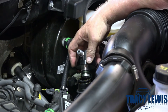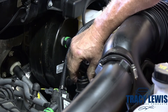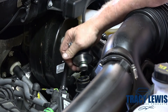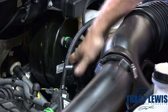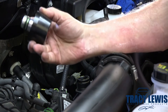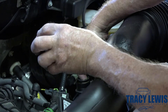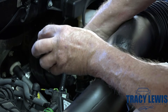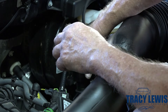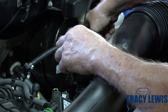We're replacing the stock oil fill cap with one that we've modified the base of. Put that base in — it might be a little tight — give it a quarter turn so it goes down and seals. From now on you're just turning clockwise. Pull this off and it's going to seal with these two o-rings. There's a little green assembly grease in there to make sure it slides down okay. We're going to cut a piece of hose to go between here and here, and the sensor is going to tee right into this.